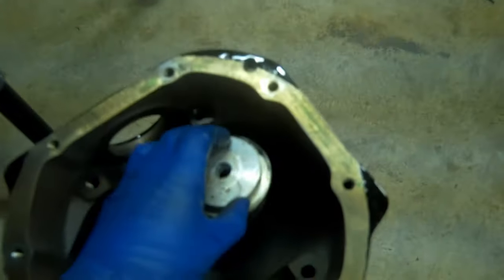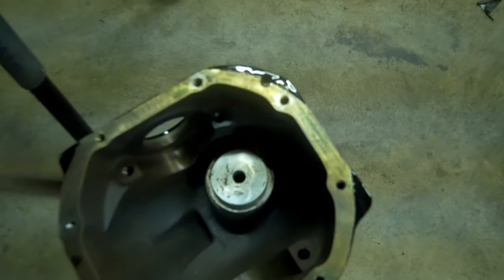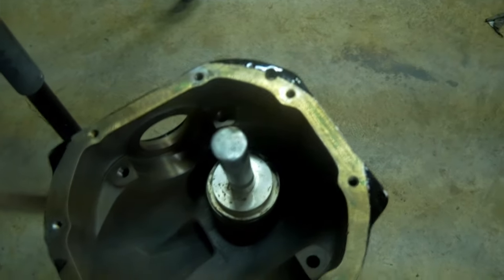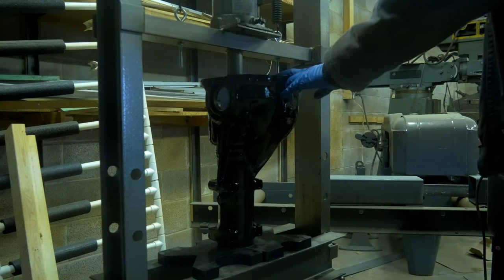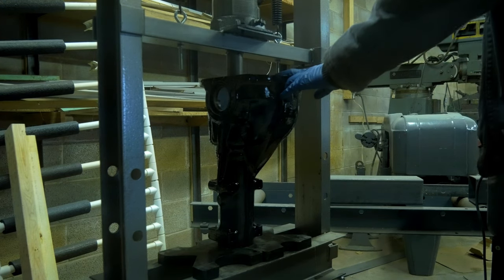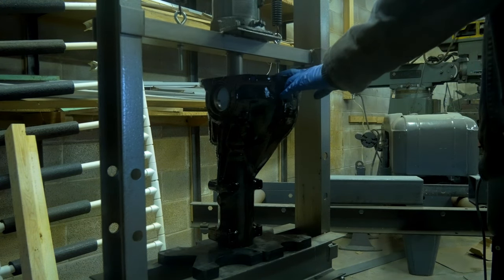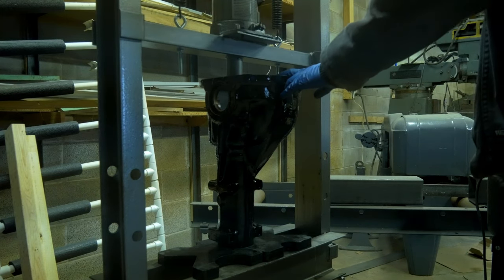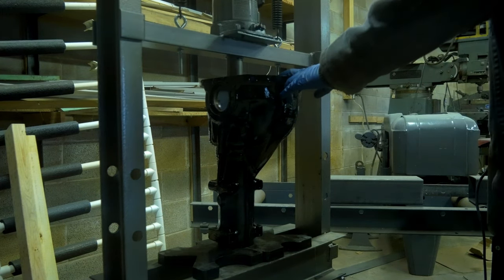We press that bearing on the shaft, again, with the pinion spacers where they should be, and now we're just getting to setting the races in the diff. Now I'm just using a pretty generic seal and race driver set. There's an Amazon link in the description below. If you don't have one, they're a great tool to have, and as you can see, I'm not beating it in with a hammer, and I highly recommend not beating them in with a hammer.